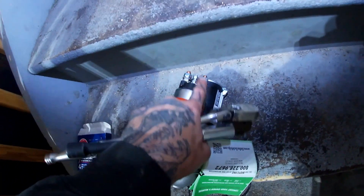I came in through the passenger side wheel well, and as you guys can see the starter is right here. I pulled the heat shield off of it — that'll go back on when we get it all back together. I kind of just pulled the starter towards me from the top at an angle, and that gives me access to all of those terminals for our electrical cables here.